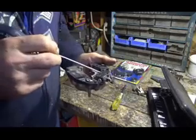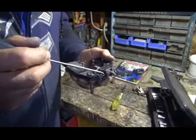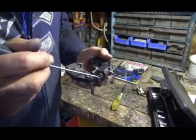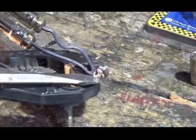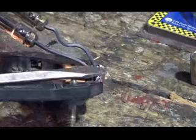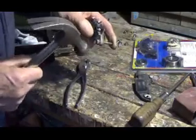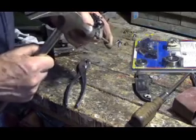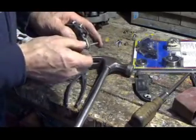Now to take this off the regulator, it's kind of the same thing — it's crimped on, but this is also soldered on, so you have to heat that up a little bit to loosen that up. And this bolt that goes to the battery post — you have to pound this one out. I put the nut on here so it doesn't damage the threads.